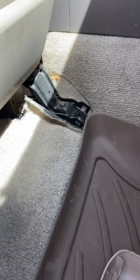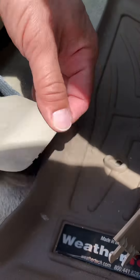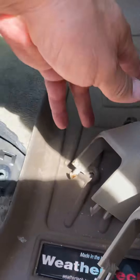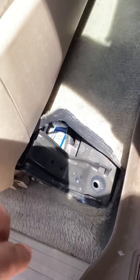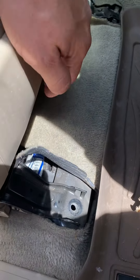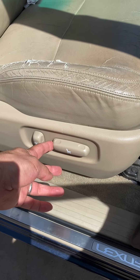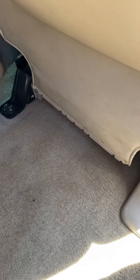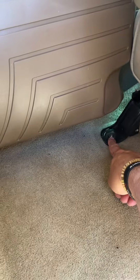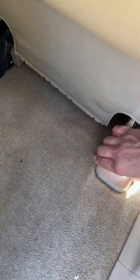If you're doing the seat covers, these flaps are right here — grab your finger underneath and lift them up, it should pop out pretty easy. 14 millimeter right there and right here, and the seat pops up. I recommend when you do the back screws to put this seat up so it gives you some room. Same thing in the back — you're going to remove these screws, 14 millimeter — and this right here, just try to get your fingers underneath and pop them out.